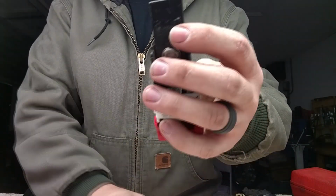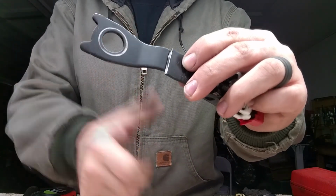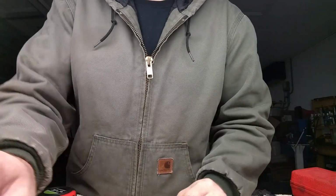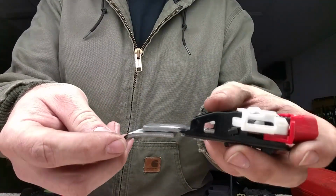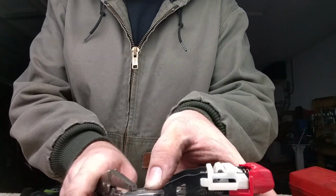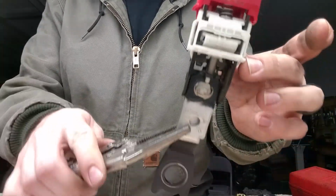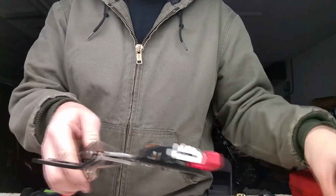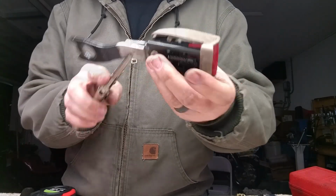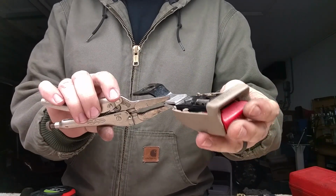I'm also going to drill a hole in the Toyota one so I can weld it through right down to the back side. So I'm going to go ahead and clean these up and drill the hole in them and prep them for weld. Got them cleaned up for weld. As I said before, this will lay right over it. So final product will look, that's a little crooked, something like that. Whole new piece, and this will still be able to have the bracket put back on whenever I'm done, along with space for the wires to come out at the end.